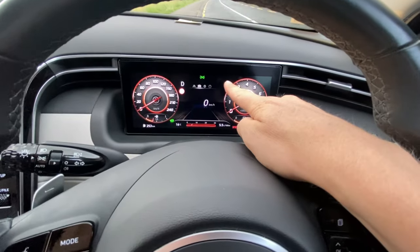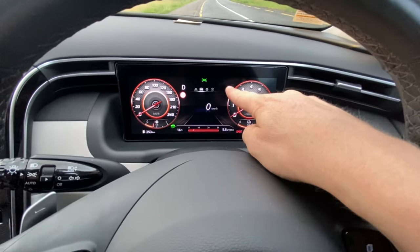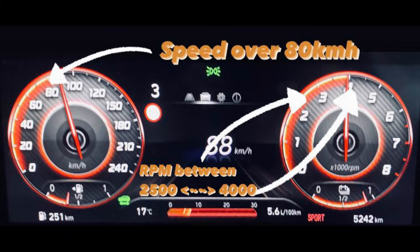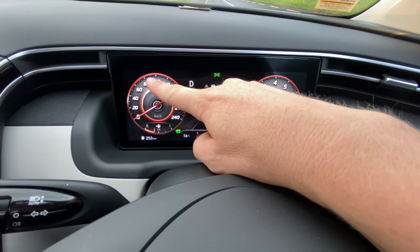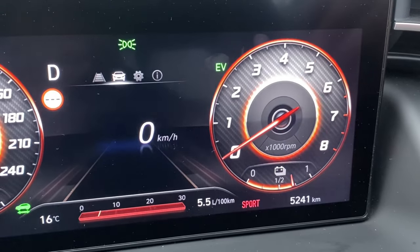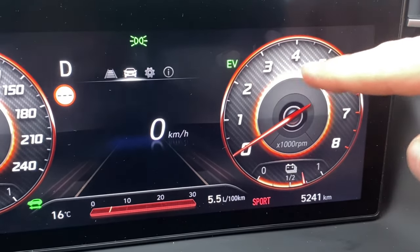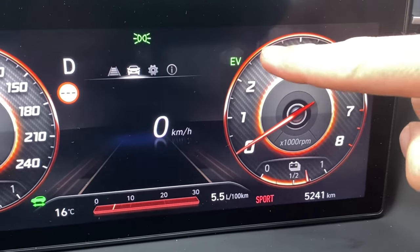The petrol is a bit different — the criteria are a bit different. On a petrol manual: over 80 kilometers an hour, up to half an hour, and you've got to keep your engine revolutions between 2500 and 4000 rpm consistently during that period. So just to recap: the light comes on on a petrol manual, you need to get to somewhere like a motorway — this will be impossible on a back road. Get your speed up to at least 80 kilometers per hour — you can do 90, 100, or 120 — and keep your engine revolutions between 2500 and up to 4000 rpm for possibly up to 30 minutes.